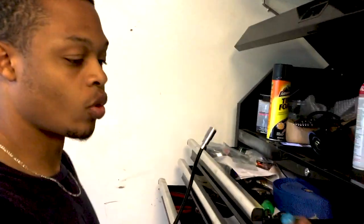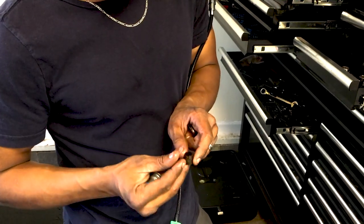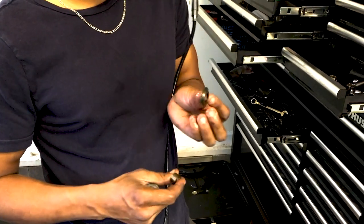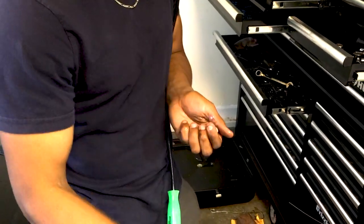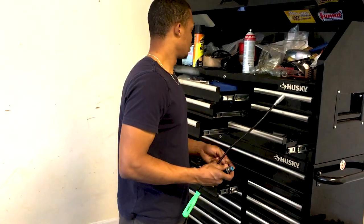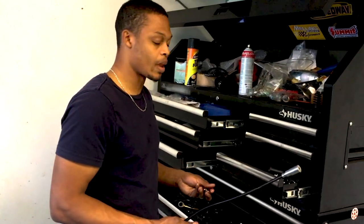See how they're connected? When you push it down, this is wedged on the sleeve for the valve and this is at the bottom. I don't know why, but this literally has play in it and can just jump up and down, whereas with the new one it's just a one piece — you slide it on. Usually the 5.3s and 6.0s I've taken apart are made like this anyway. This is an actual LS and it makes no sense — maybe somebody went in there, or maybe they did that in that year.